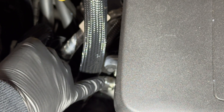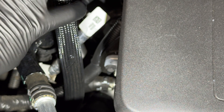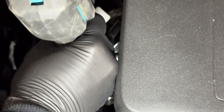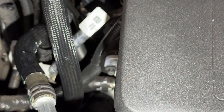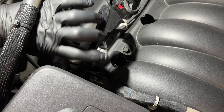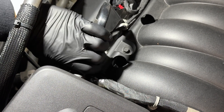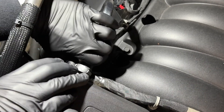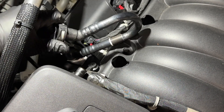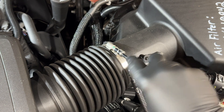This bolt on one of the flanges of the alternator is a 10 millimeter — it's just got a little bracket that goes up to the air box to support it. Take that out and save that bolt. While we're back here, remove this air vent that goes to the cover — it's a squeeze fitting, push the little gray connector, pop it off the intake, and twist it out of the way. Then come over to this 7 millimeter clamp and loosen it.